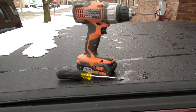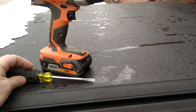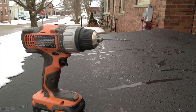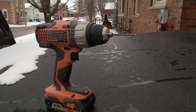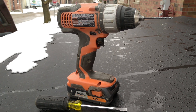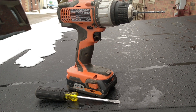The only two tools you really need for this is a flat-head screwdriver to pry open a few tabs, and a drill with a 1/8 inch bit — smaller or bigger may work as well. All we're doing here is we're going to expose a check valve, drill out the internals of that check valve, and that seems to clear things up.